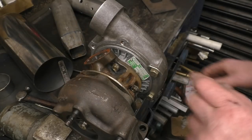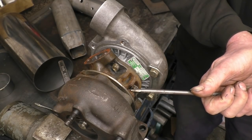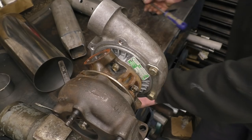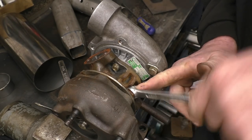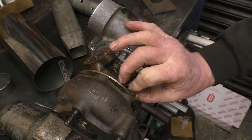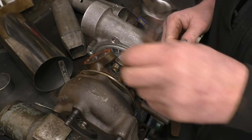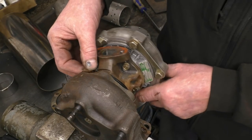It's held on by 8mm bolts which are held in with locking tabs. Normally these don't come apart because normally turbochargers have done a lot of work, but this one's virtually brand new, so hopefully they're going to come straight out. They're normally seized in and you've got to put heat on things to get them apart. I've never seen the turbine wheel inside this one before - all the bolts have come out quite nicely.